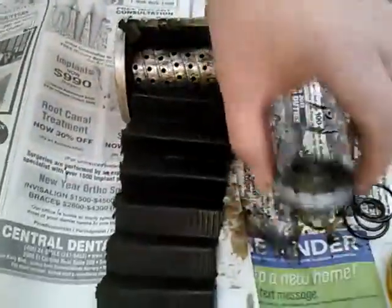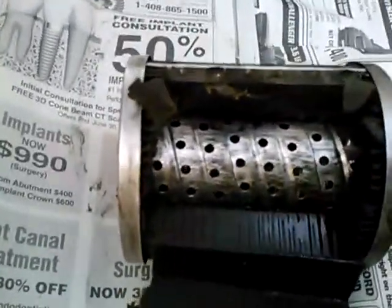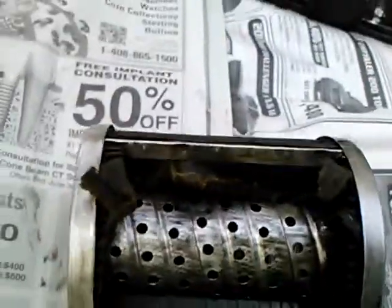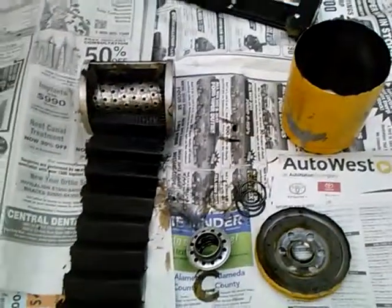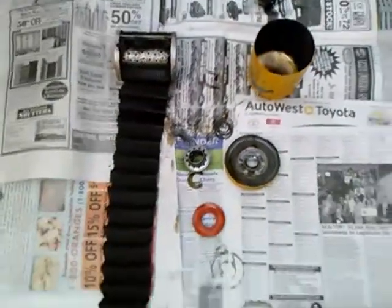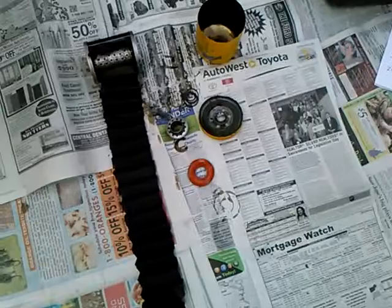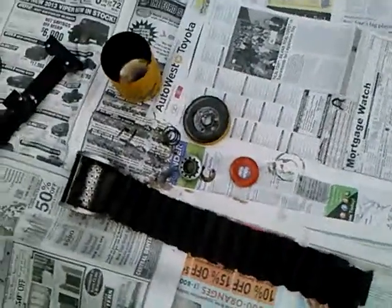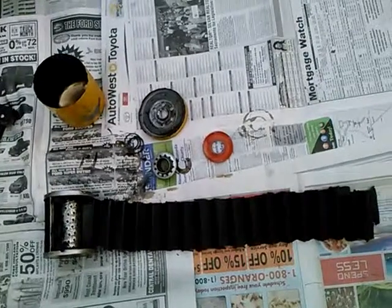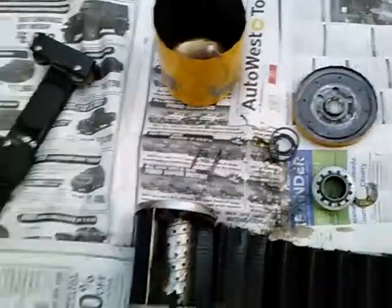One would think the bypass would open before the tube was threatened. So I am confident that no harm was done leaving this on the engine for 24,000 miles. It does mean I don't change them that often — it'll be two or three years before I can do another VW oil filter teardown. I've got a Mobil One filter on there now. Thanks, and be sure to watch my other videos.